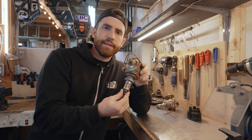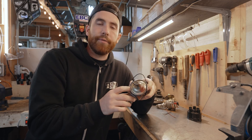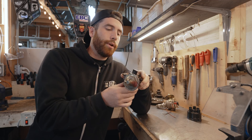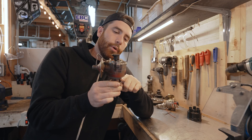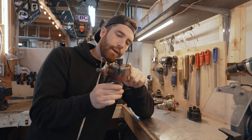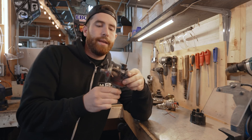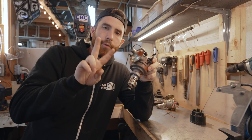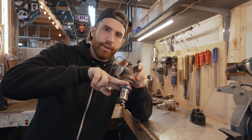However, sometimes it's hard to see if the distributor is installed in the engine, or if it's an aftermarket distributor that didn't have this stamp. So the second thing you want to do is visually inspect from the outside. This is a 59D distributor — you can tell because it has a little bit more of a squared-off body. The cap is also a little bit more squared off on the top. The clamp that holds it to the engine block is a Y-shaped clamp with one bolt that goes in and holds it in tension against the block.